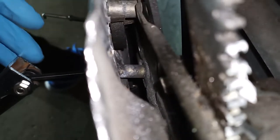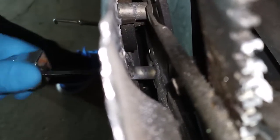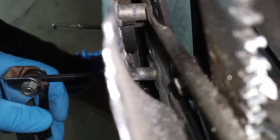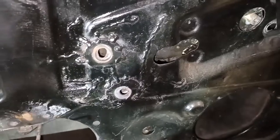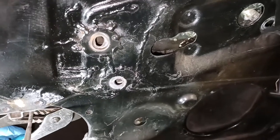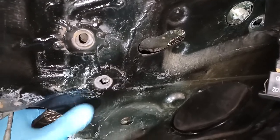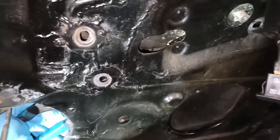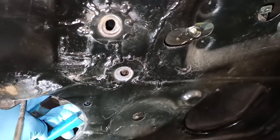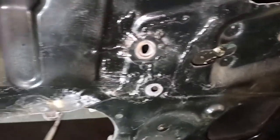Here's a closer look. Since I've got this giant cutout hole in my door, I can show you from the back what's happening. So yeah, I'm not sure if this is a typical problem, but just something to watch out for. Okay, I was able to get some channel locks back here in the gap between the backside of this door skin and the regulator mechanism. You can see my channel locks right here. And then I was able to grip the cylindrical standoff and then remove the screw. And then things started falling out.